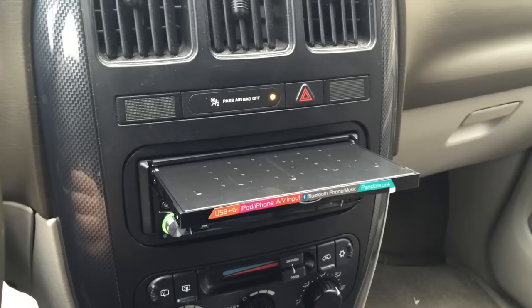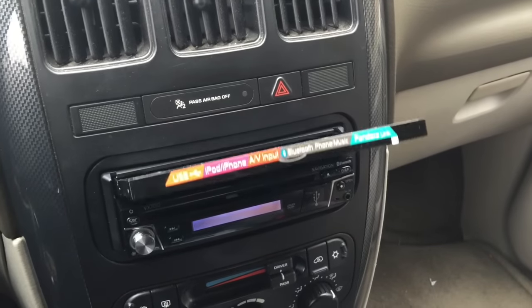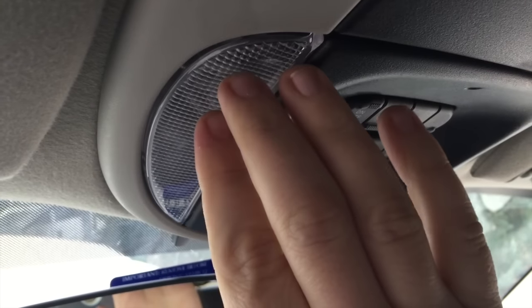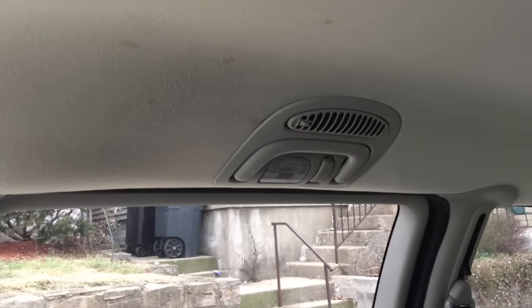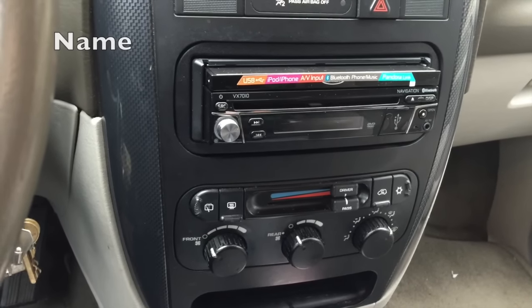The radio — although this is my new Jensen radio, I'm going to guess the factory radio will behave the same way. Normally there would be a longer pause before the radio shuts off or until you open the door. Interior lighting: normally this is supposed to come on when you push the button — nothing. Now I'm going to turn the flashers on — I've got flashers and lights. Additionally, you could have HVAC issues; I've also heard of other radio issues and the vehicle not starting.